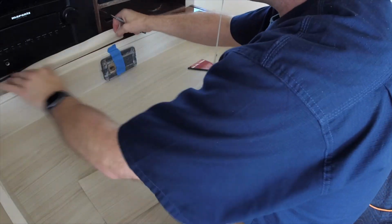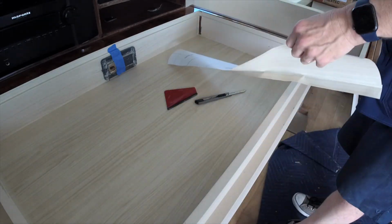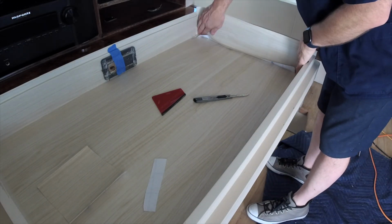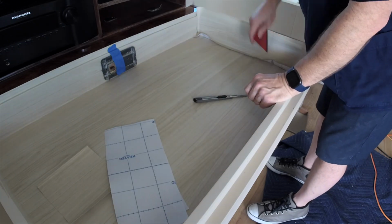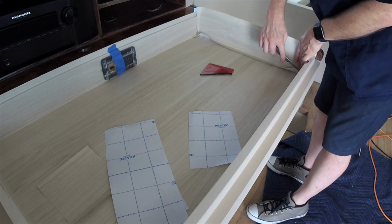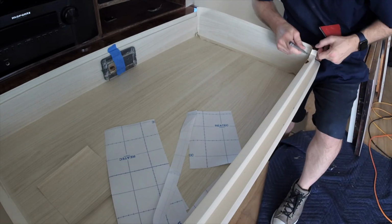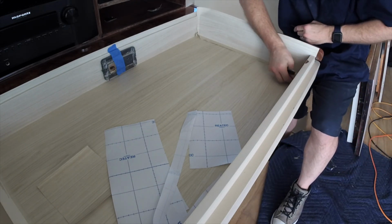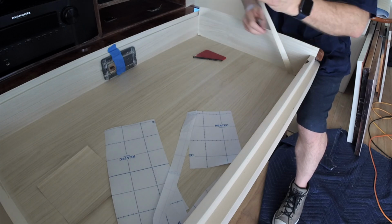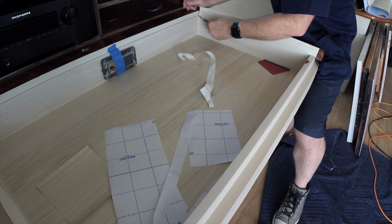There you go. Same kind of concept. I have a tacking on strip right in the middle of the unit, and right there, tack it on right there. Have a 1 inch or ½ inch to 1 inch gap, left, right. I folded it right on the bottom part, so it's easier to install it when you're fighting it less. Again, press lightly when you're doing a vinyl on top of vinyl.